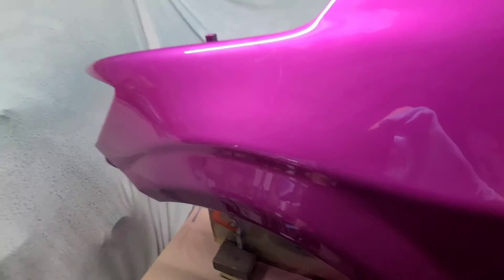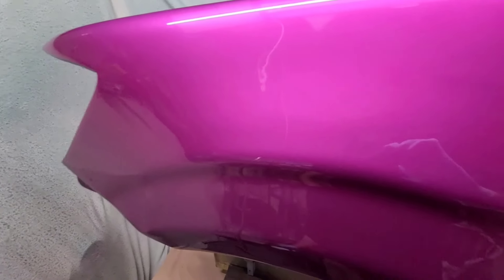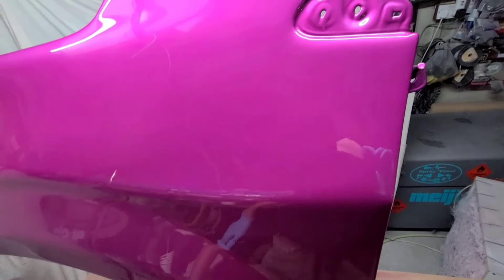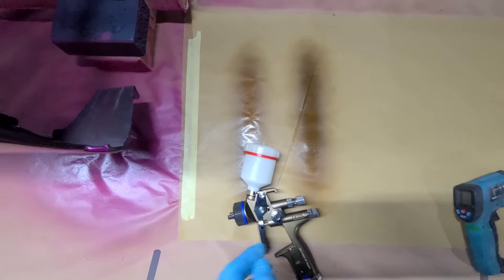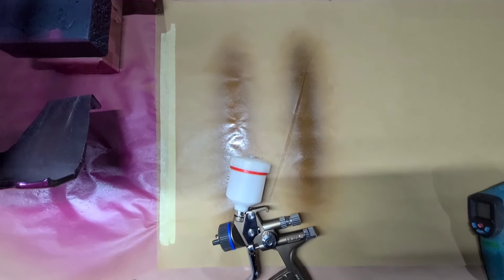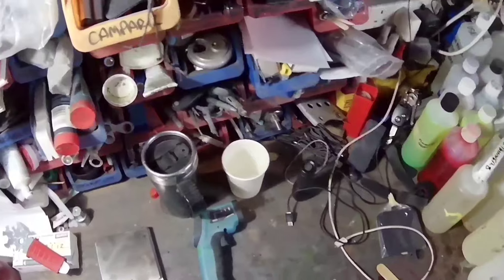To tell you the truth, looking at these two, spraying in colder conditions is a bit more difficult anyway because you need to be careful how much material you put on. But when you actually looked at these two with the human eye, you could see a flatter finish from the CC. And as I said in my original video, it really can produce very flat finishes. So it's ideal for custom car makers and people like that who want to take their time over doing something and don't mind spending that extra time achieving a really good finish. I don't think it's going to be any good for production work, because it's just not really fast enough.